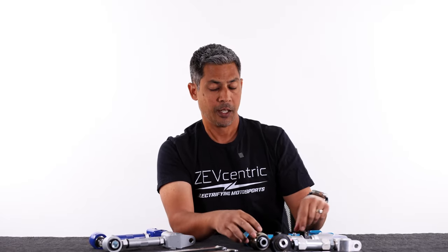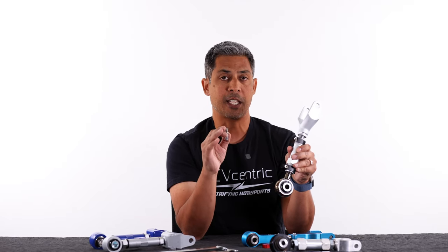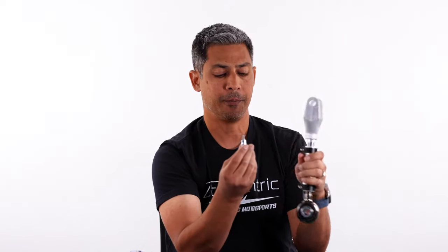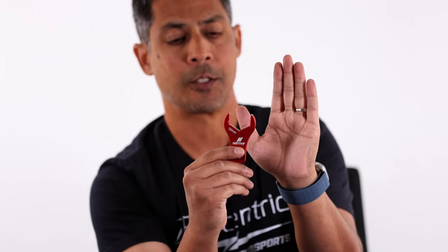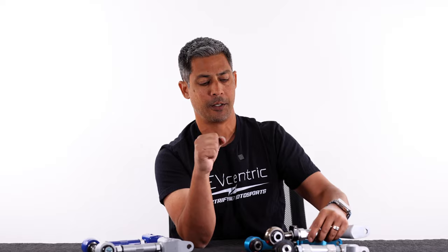On the Intuitive arm, I actually really like this design. They use an actual clamp — SPL uses a similar design as well. In order to loosen the clamp, you'll need a T30 Torx. That will loosen the Torx bolt in here so this clamp can swivel. Once that is loose, you can use a 30 millimeter wrench — we just use a crow's foot because we had it. The 30 mil goes on the turnbuckle and you can turn this to get your adjustment. Once done, take your T30 and tighten the clamps back up nice and tight.